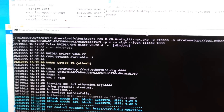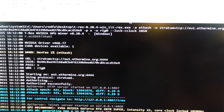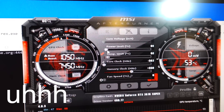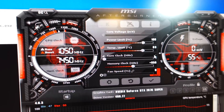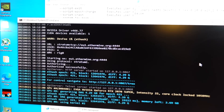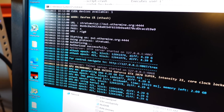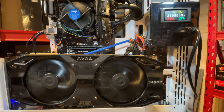Now open that batch file and run as administrator — it'll start mining. You can see 'GPU 2070 Super core clock locked at 1050.' A couple of other things: adjust your MSI Afterburner settings. Set your power limit to 100, leave your core clock at zero since T-Rex handles it, and your memory clock is really the only thing you need to worry about. Wattage is already way down to 120 watts for the full system.